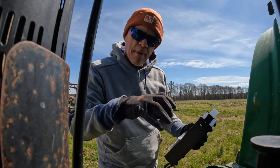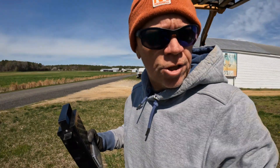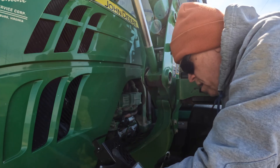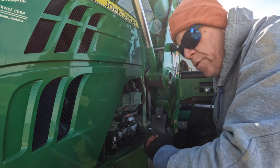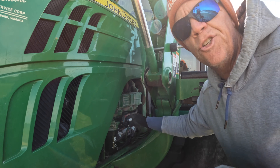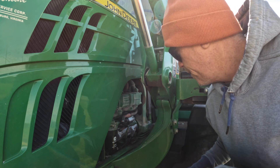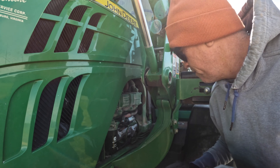The battery connection seems to be okay. Let me come over here and try this positive wire. Okay, I'm losing a little bit there. So what is happening — when I had farmer's daughter here the other day checking this — when I am hitting the starter, I'm losing power on this wire. I'm not getting 12 volts here, so I think it's an issue from this wire.